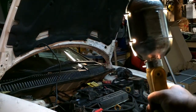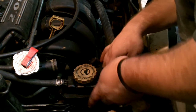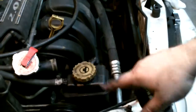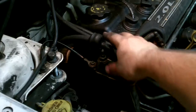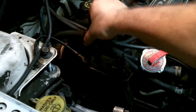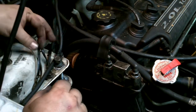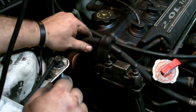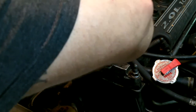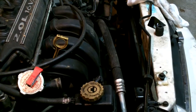All three bolts are out and the pump sits in this bracket here. There's also a 10 millimeter bolt holding the power steering lines in place — I need to take that off. That was the 10 millimeter; I'll put that grounding strap to the side. Now these lines are free to move. I'll put the 10 millimeter bolt back in here so I don't lose it — this whole bracket is coming off anyway.